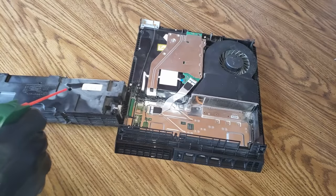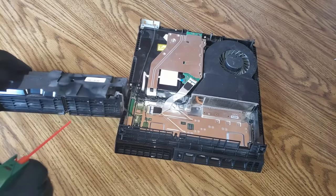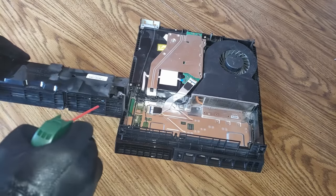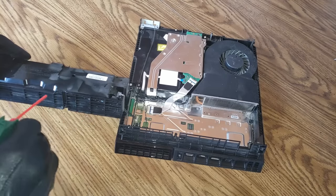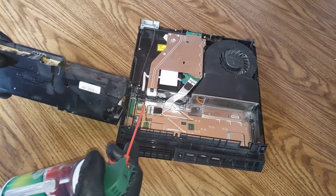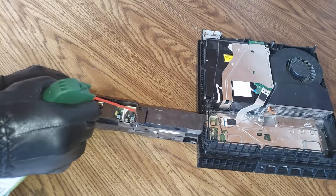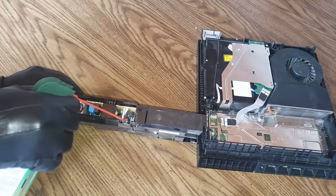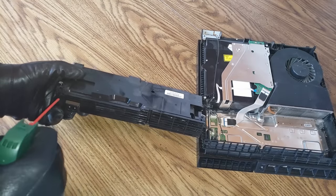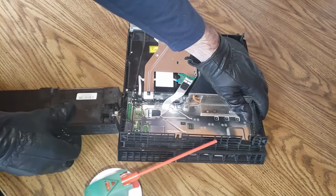Let's go ahead and take the compressed air and spray it down. I'm spraying off the top, however on the bottom you can see there are a lot of little slots that you can spray into, and it's very important that we spray the air through those to get rid of all the dust collecting in there. I recommend doing a very thorough job when spraying the compressed air through the power supply — the better job you do, the cooler your PlayStation 4 will run. I bought my PlayStation 4 in 2013, so that's about 6 years of collected dust. Let's slowly turn the power supply unit over and spray into the front; all the dust is now being sprayed through the vents in the back. Remember to do short bursts with your compressed air so no residual liquids form on your power supply unit during this process. If you do notice some liquids forming, give it some extra time before plugging it back in.